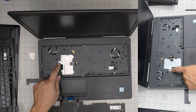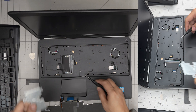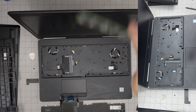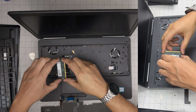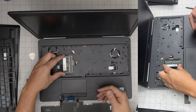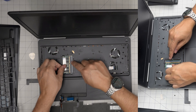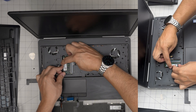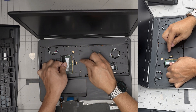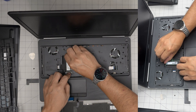Remove one screw right here, then lift up the cover — and there are two more RAM DIMMs right in there. You can put another 16GB in each one, giving you 32GB on that side and 32GB on the bottom side for a total of 64GB. Make sure the notch is matching, push the RAM all the way into the connector — not halfway — then push it toward the motherboard until the triggers click in.